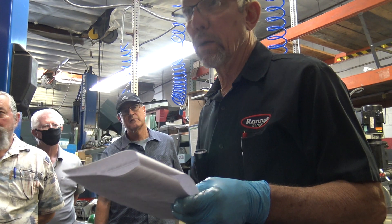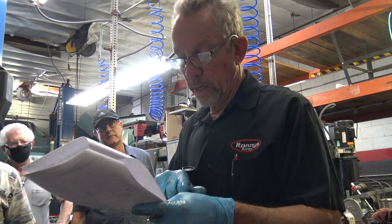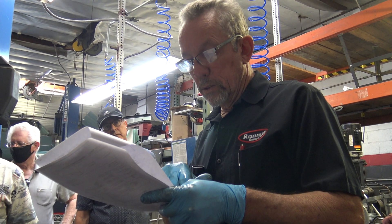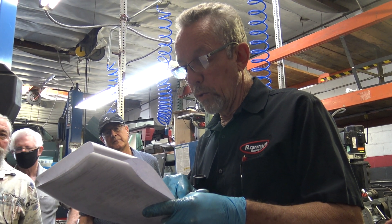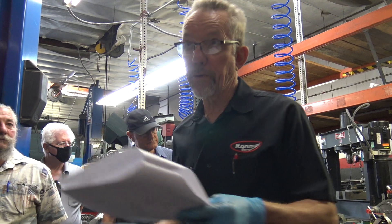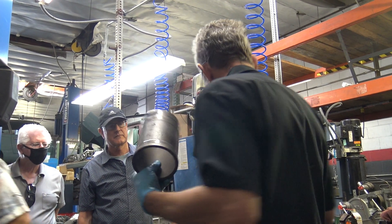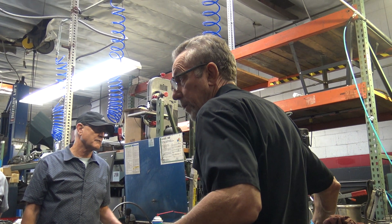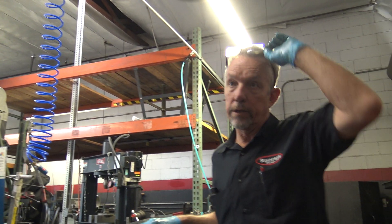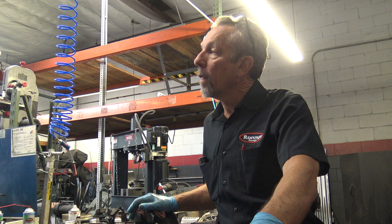So we're talking really small differences, and the pistons are the same way. An H piston — you're supposed to match them. An H piston is 4.0985, which is 1.5 thousandths, to 4.0988, which is 1.2 thousandths. So they come in different gradings, very minor differences. In the real world, if it's under 2 thousandths, you typically won't hear it. 2 thousandths is a lot on that grading. So you just mic your bores and then determine which set of pistons to put in it.